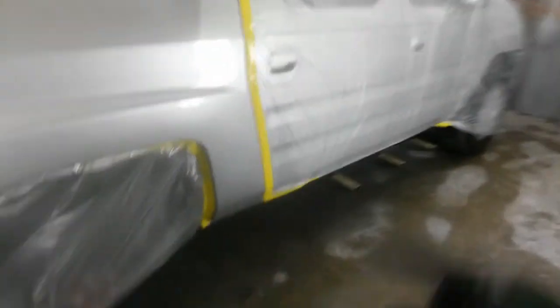It's been about two weeks since this thing left, but he just brought it back for the stripe. I had to order it - 3M doesn't offer this pattern. This one is a little worn but it's the closest thing I could get. Got it installed - wraps around to the tailgate, got it aligned. Didn't have to buff anything on this one. He just dropped it off about an hour ago. Here's the blend into the original paint. I wet sanded all that with 2000 just to take the fuzz out, polished it with the 3-inch polisher, and it's completely gone. Next video will be the 2011 Odyssey. That's all for this one - see you guys on the next one.